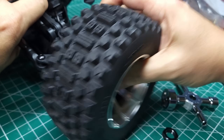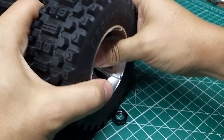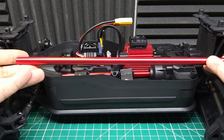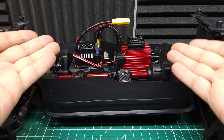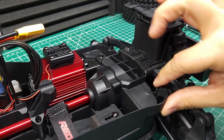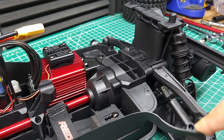It's a great time to go ahead and get subscribed to the channel — we do ultimate teardowns on all new vehicles and you're not going to see that anywhere else. Removing this center brace, we can see this is a solid bar of aluminum that definitely isn't going to get bent in normal bashing. However, it only prevents the chassis from flexing one way, not the other, because it's not positively retained on the ends. These guards are held on with more screws than I thought, but they will fold out of the way.